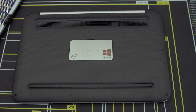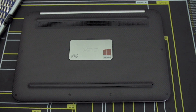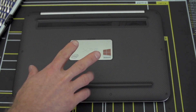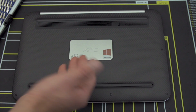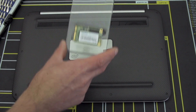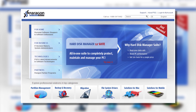The first step is really more of a before-you-begin thing. Because we're using mSATA, it's a little inconvenient for data migration — we can't just use one of these handy USB-to-SATA interface cables to clone the drive before the transfer. What we'll have to do is actually back up everything that's on here. The good news is that because it's a factory loadout, there's not that much data, so you can back up to an external hard drive or even a large USB key, then manually transfer everything back to the new mSATA drive once you're done. We're using Paragon software for the backup and restore.